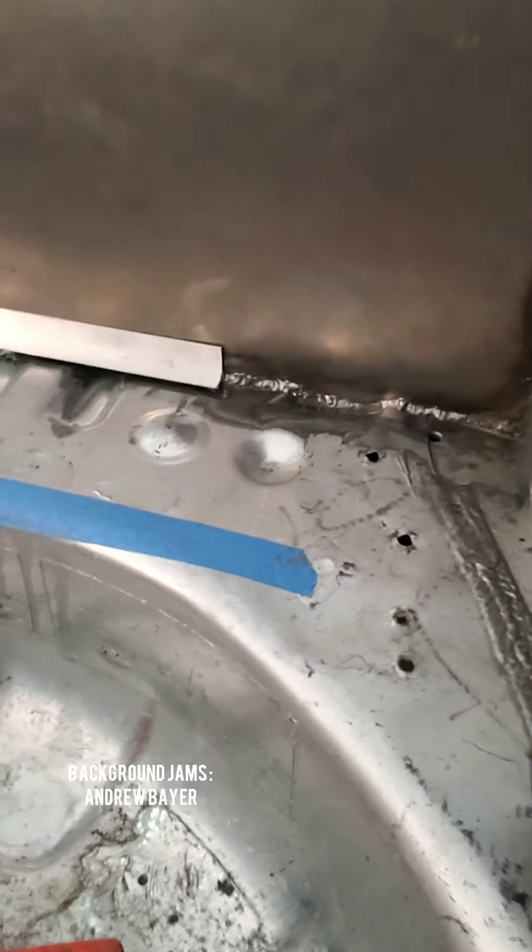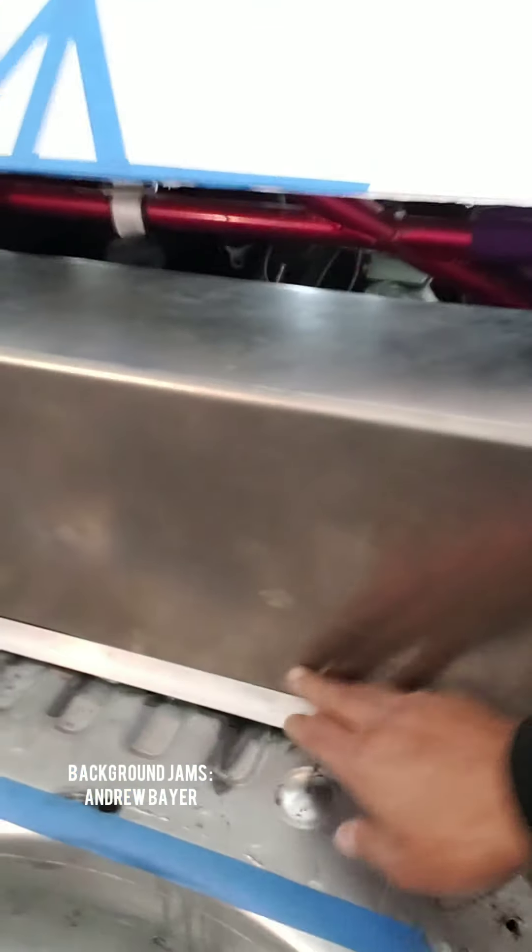I set it in there and a couple parts hit, so I had to cut out a couple small intricate details, but now it fits pretty good. I'm going to take it out, clean it up, make sure there are no sharp edges, then drill two holes and rivet nut it in. The small tiny gaps on the left and right — because it has to be 100% sealed — I'll put a little bit of silicone there. I just didn't want a bunch of silicone all over the back of the car.